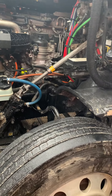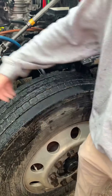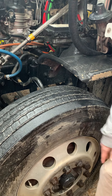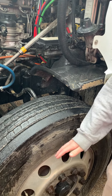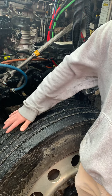After you hit that, you come to your tires. Start with your rim — I like to start inside and come out. I got my inside and outside rim, properly mounted and secured, nothing been broken or cracked, and it's free of any illegal welds or holes. Inside and outside tire wall, it's properly sealed to the rim — no bulges or cuts, and no leaks. I got my tire tread — it's evenly worn, no bulges or cuts, and no leaks.